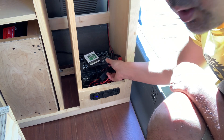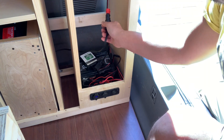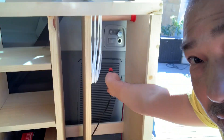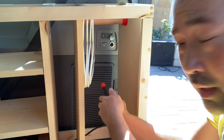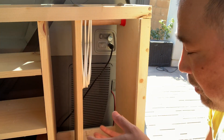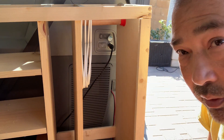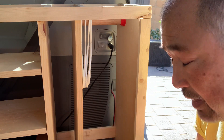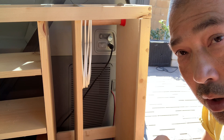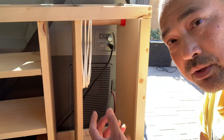The reason I don't hardwire the refrigerator to the battery is because there's also a port up here that connects to the car while driving. So on a long trip, if I want to recharge the battery and not use it for the refrigerator — arriving at the campsite with a full battery — I can run the refrigerator through the car while driving. Both ports are right here, so it's nice and simple.